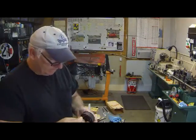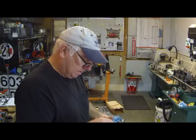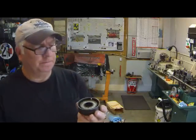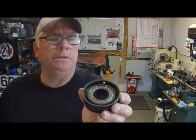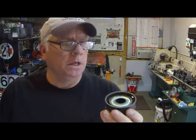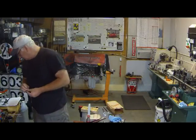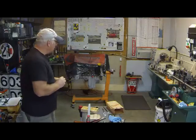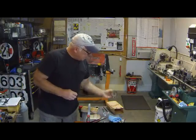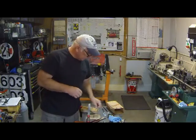And again, we can try this for fit. And that's actually going to fit. That works out pretty well. Don't know if you can see that too easily, but that rivet head now fits within that valley or that recess in that ring. So, with that done, we need to do three more of those, and I'm looking now for my 1-inch mic, because I do also want to open up these holes and place this rivet inside, and we'll go on to the riveting process.